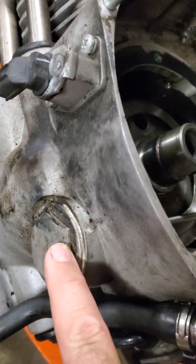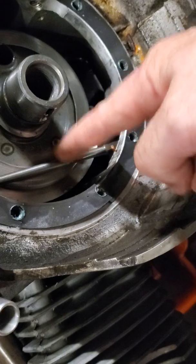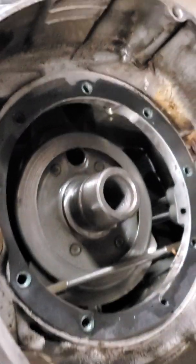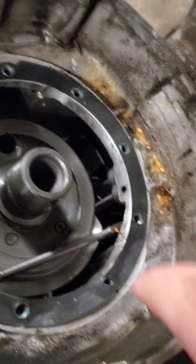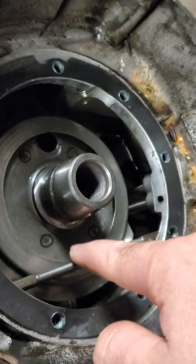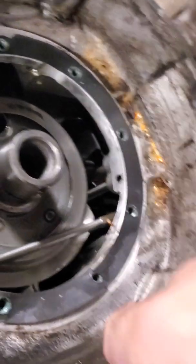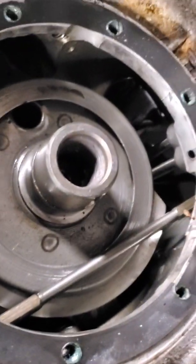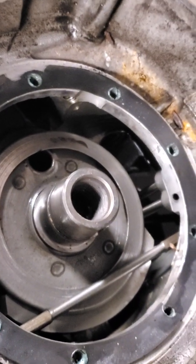This cover houses the drive for the oil pump. If you look down in here you can see this shaft. Now the way this works — this is not a pressurized oil system. It does have an oil pump, but what the oil pump does is push oil to locations where it can just cover things, like this cup right here. There are spot welds that hold on this cup, and it collects oil to use centrifugal force to push oil into the rod bearing. There are a couple little holes right there — so the rod does not receive pressurized oil.